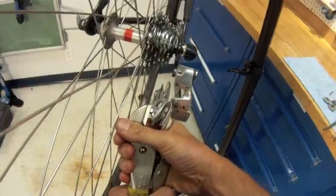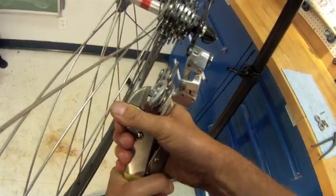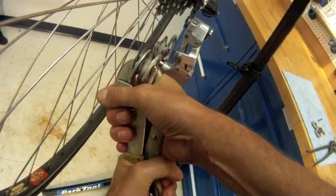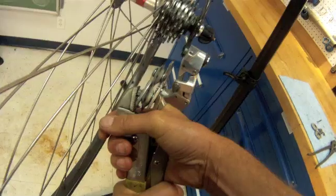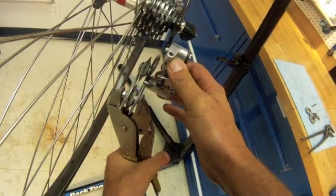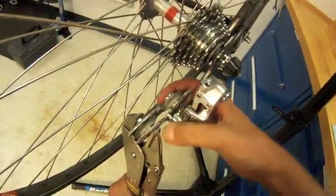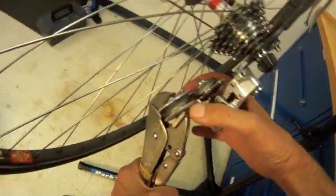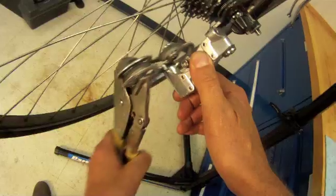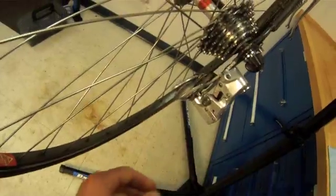And let's come back and see if we hear any loud snapping noises. That would be a sign of death for the derailleur there. No snapping. Metal, when rebent in this fashion, is actually hardening. It's work hardening by bending. There's not a lot of stress on these cages, so this is a situation where if it survives the repair, it's going to survive the use.